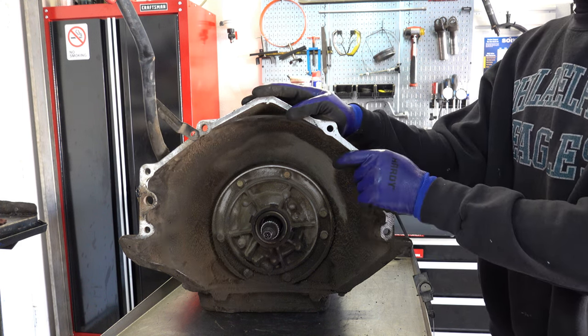What happens is this lip seal will wear out and harden, and it will begin to wear out the inner sealing surface of this piston housing. So when it goes back in, you'll hear air blowing by, and that faint hissing sound is air rushing by that seal. So if you see burnt forwards, also suspect a worn forward piston housing.